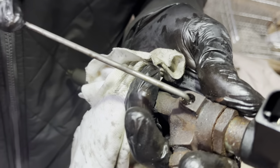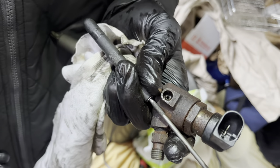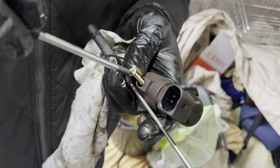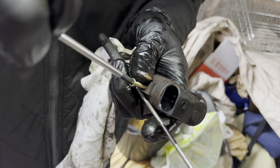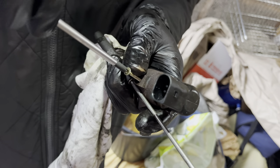So we've got injector one out and the pipe broke in there as well, so we're trying to get it out. I'm going to try a self-tapping screw, see if that works. Anyone's got any better suggestions, let us know in the comments. How would you get a piece of broken pipe out of an injector that's still a good injector? It's a £300 injector — you don't really want to replace it just because there's a broken bit of pipe in it.